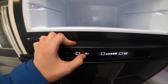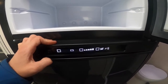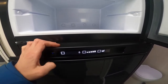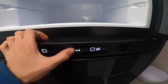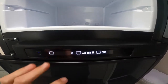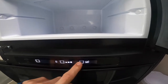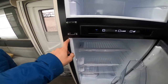You can change it manually: mains shows as 240-volt locked as mains household fridge; battery code 6 means 12-volt because the vehicle's not started; gas you would use when wild camping with no other way to cool the fridge. For temperature, put it on five — full blast when cooling down. When you put your shopping in you might want to turn it down as it can sometimes freeze both the fridge and freezer.